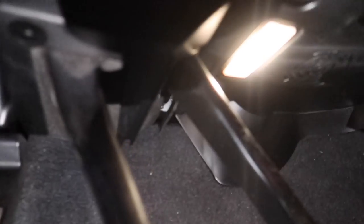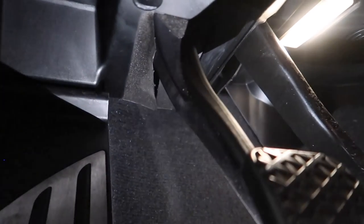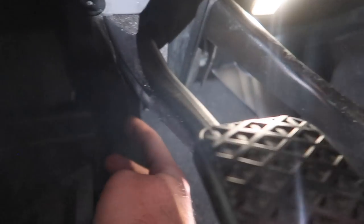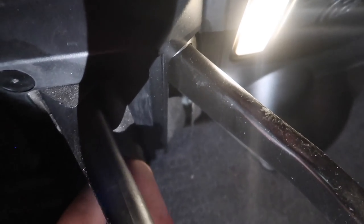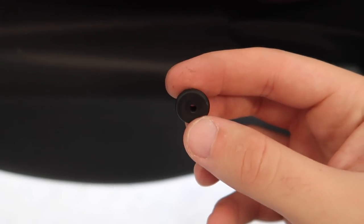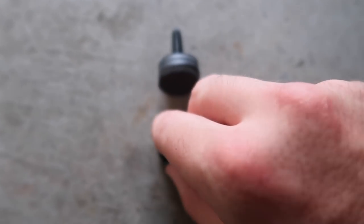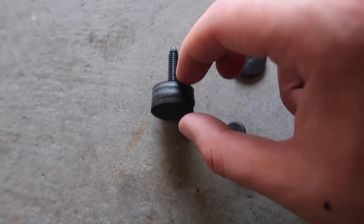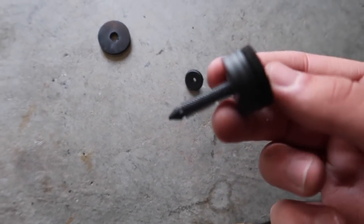So this is the original pedal stopper I pulled out of the car — it's a very, very tiny piece. The Burger Tuning one is a lot bigger. I took off one of the grommets, so I'm comparing the two thicknesses — it should be a big difference. Let's go ahead and install it. Just like that, guys — the new piece is in there. Can you see it right there? That is the Burger Tuning pedal stopper, sitting right there. As I push down the clutch pedal, it's basically just going to feel like half an inch or an inch shorter. I only put two layers out of three, so it shouldn't be a crazy difference but should make it easier to drive.